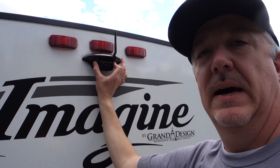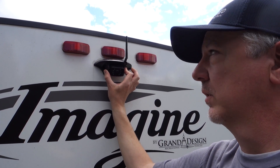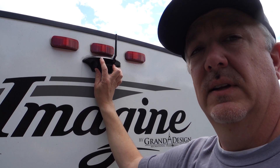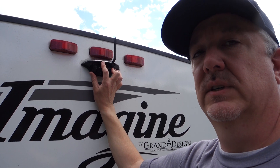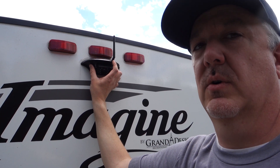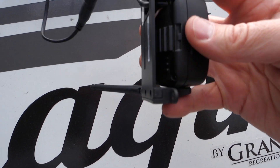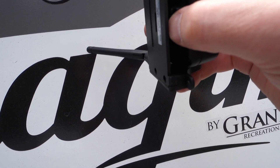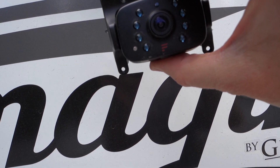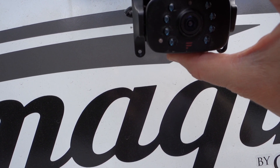Once you get this seated back into the bracket, just use the screws that were holding on the plate. I'm going to caution you on two things. One, these screws are really small and this is a plastic housing so you can over tighten them — just tighten them so that they're seated but don't crank on those. The second thing is the backup camera itself has an adjustment with just these plastic teeth, so you can tilt this up and down once it's in the housing. Just make sure that when you do that you do it very gently because you will strip those gears out.